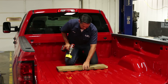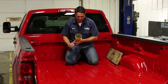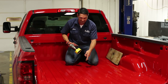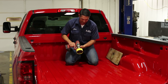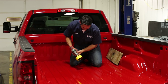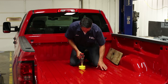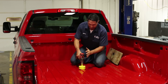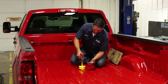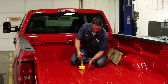If you don't want to mess around with the board — and this takes a little more saw control — a technique I like to use is to run the drill in reverse to establish a cutting groove, and then switch the drill back to forward and finish the cut. If you're using a cordless drill, you're going to want to use the slowest speed setting possible. If you're using a pneumatic drill, use good positive finger control to keep the speed as slow as you can.